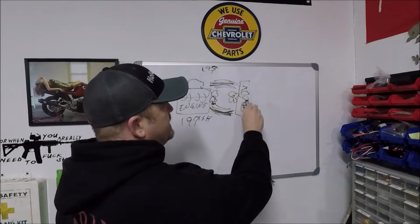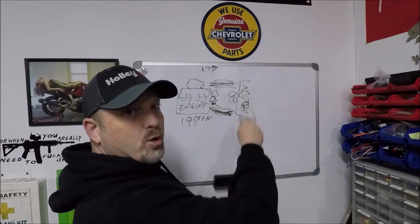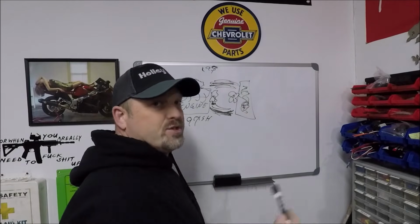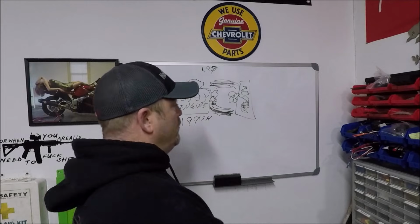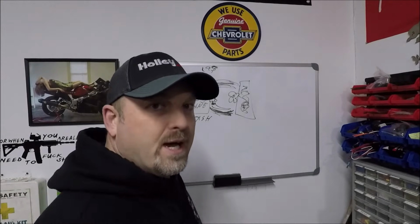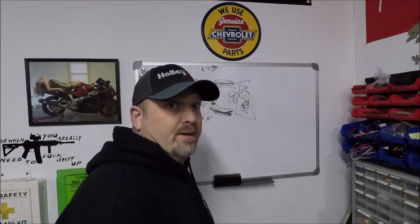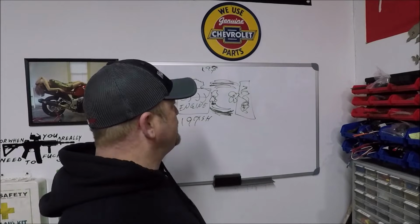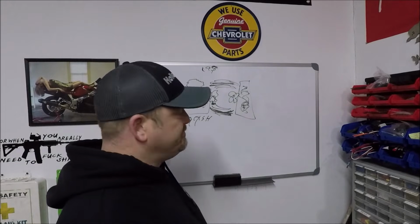It's going to be continuously pumping it through the radiator, which is cooling the coolant down and pumping it right back through the engine. It's just never going to get warm. So what you're going to have there is in the wintertime, you're going to have no freaking heat. You're going to think, dang, this engine runs really cool, man. I'm glad I took this thermostat out.